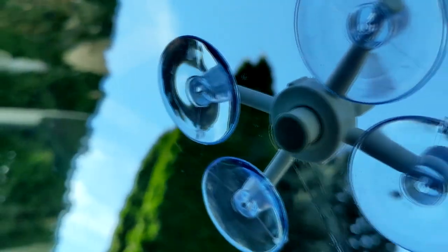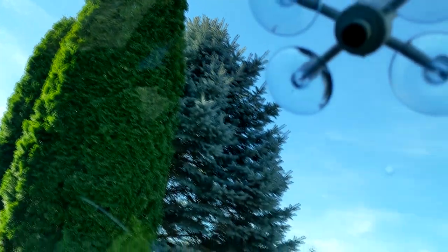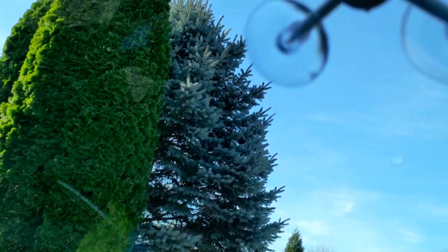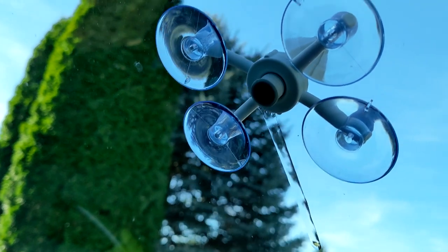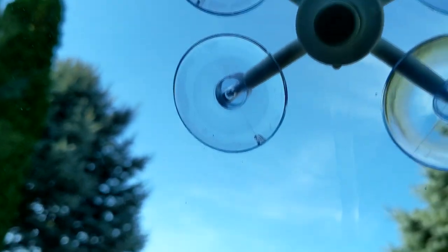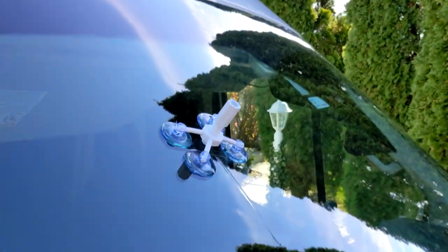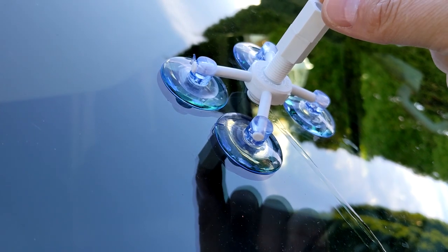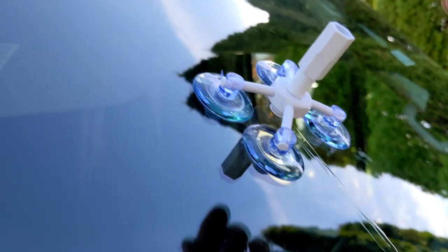I had to shift it a little bit to get a better location because one spot looked like it wasn't getting any resin. This little drip on the bottom is not a big deal. If you're not sure at this point, it would be okay to unscrew that pusher and put a few more drops in there. If you look from inside and can still see some of the chip showing, unscrew the pusher, put a few more drops in, and retighten. In my case it looks pretty okayish.